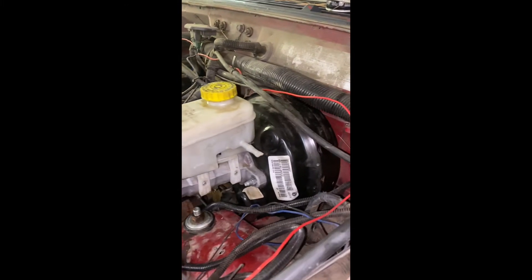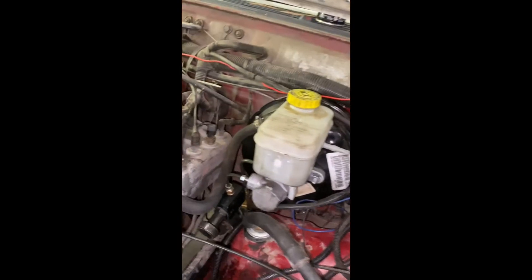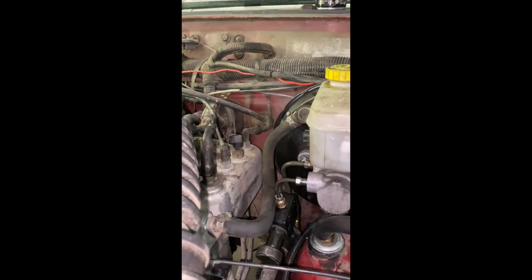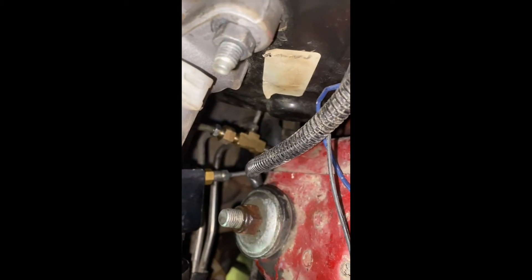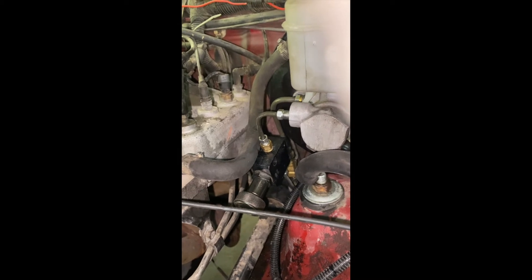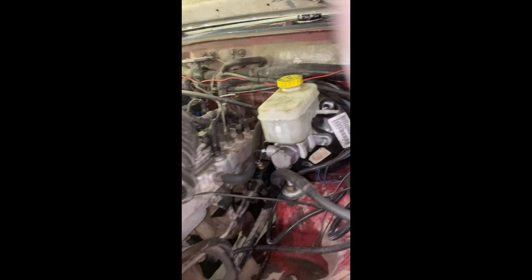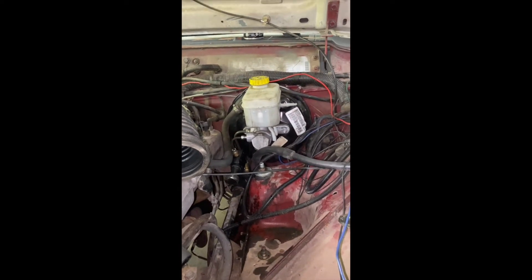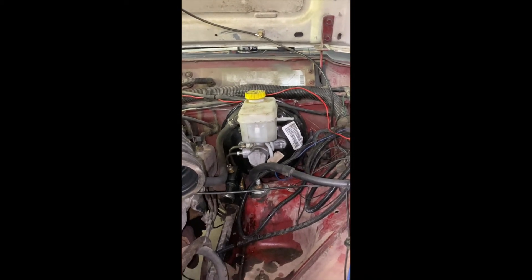Installation fits pretty well. Got to bleed the whole system, obviously, top to bottom. I had to put in a T-fitting down there. There's the brake proportioning valve I have for the rear line. Pretty straightforward. Work out all your fittings before you get involved and start the project. The last thing you want to do is get it all torn apart and go, 'Oh crud, I don't have that,' and then you're stuck with a rig that's all torn apart.